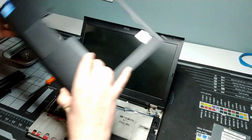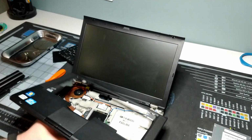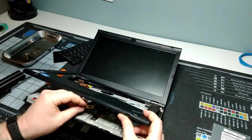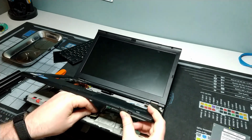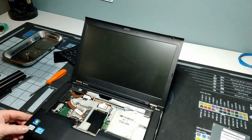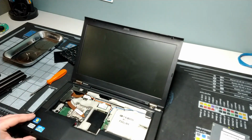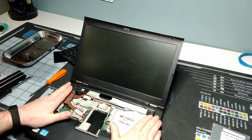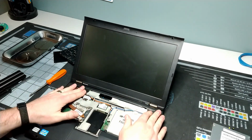All right, next we will put our touchpad back on. So I want to get our plug back in first. As you can see here, gotta line it up since it is plugged in 2 places on the touchpad. There we go, we are plugged in. And then to put this back in again, we want to get our little parts at the back here that go underneath and beside the hinge first, and then just lightly snap everything down back into place.